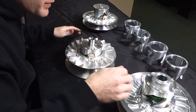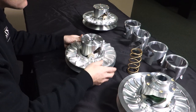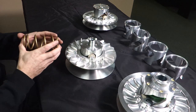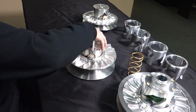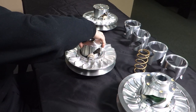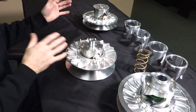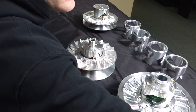When choosing spring rates, what you're going to be using the vehicle for is one of the biggest deciders of how the secondary is set up. The secondary is really going to give you your shift feel and how the car reacts to what you're doing with the throttle. A scenario where you'd want a stiffer spring and shallower helix would be if you added larger tires or you're planning on doing mud bog, high-load situations. That's going to hold the car in lower gear longer — like accelerating through a mud hole in second gear rather than trying to go through it in third or fourth — giving the engine and belt system a better chance to get through it in the proper ratio.